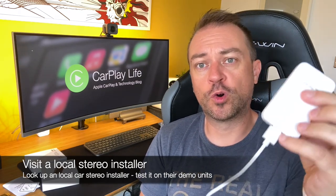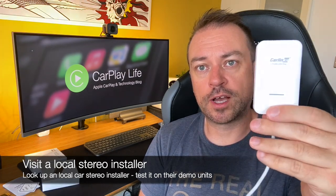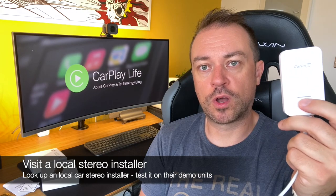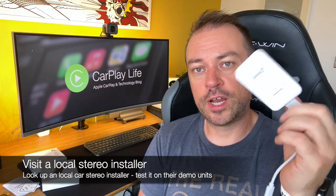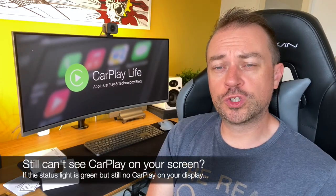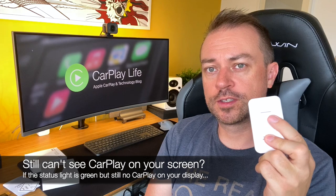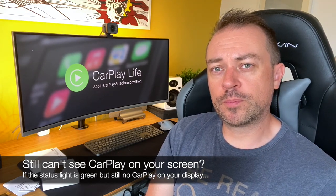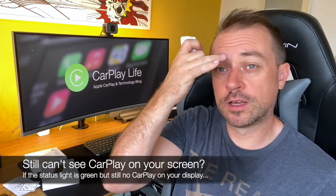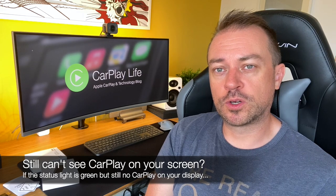What you're looking for when you plug it in: if the light turns red, that means there's an error between the dongle and the system it's trying to operate with. You want it green — it may flash while operating. Once it's green, tap the CarPlay icon to activate CarPlay. If it's showing green but CarPlay still won't run on your display, it's likely your phone is the blocker preventing the system from entering CarPlay mode.